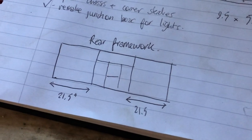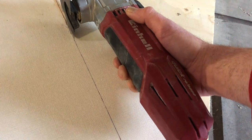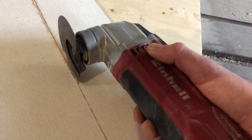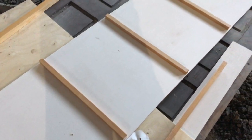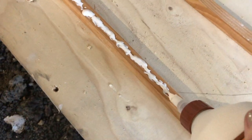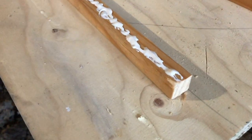I started by making a plan of the internal framework when I was doing the repairs to the back of the caravan. I've cut the draft board using 3mm plywood — it's very strong, very lightweight, and happens to be the same material I've made the walls out of. It's very easy to cut with the multi-tool and gives a very neat cut. I then carefully measure where the battens need to be placed to space it away from the wall, making sure they hit the support battens in the wall. These are all glued using strong wood adhesive and screwed in place just for good measure, then it's ready to flip over and attach to the wall in the caravan. The screws for the batten show me where to screw through the whole piece into the wall, making it extremely strong and giving the required effect of allowing air to circulate around the back of the seat cushion.